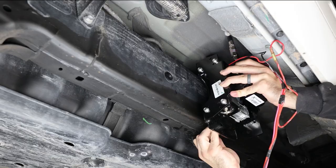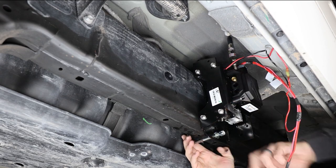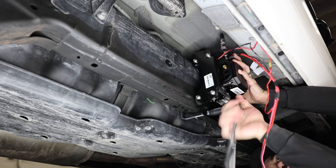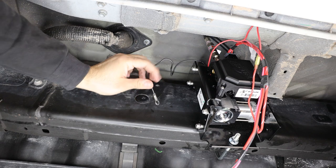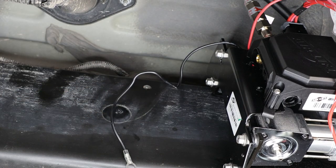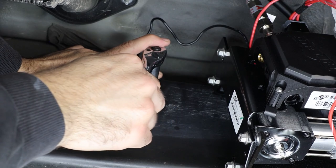Mount the air compressor onto the passenger side frame rail using the provided U-bolt. We're mounting the Wireless ONE system behind the body channel with the electrical connector facing upward. Slide the U-bolt over the frame rail through the easy mount bracket, add two washers, and tighten with the nylon lock nuts. Connect the black ground wire to the frame rail — you can drill and use the provided self-tapping screws, or use an open tapped bolt hole on the frame rail if available. Sand it down to expose bare metal and attach the ground wire.